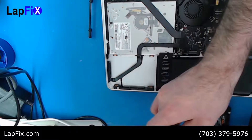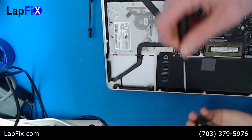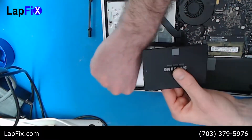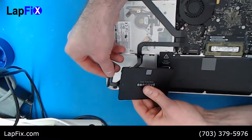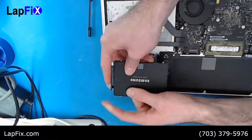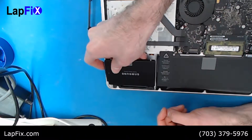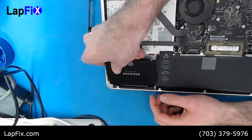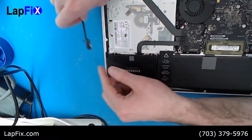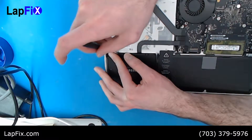The other size is 3.5 inches — quite a bit thicker. Once you have the new drive ready, I like to connect the ribbon cable first, get it really close and make sure it matches up. There's only one way to put it in anyway. Once lined up, push it in and go down so the rivets line up with the orange holes, and it'll fall completely flat. Then you can put the bracket back on top and screw it in.